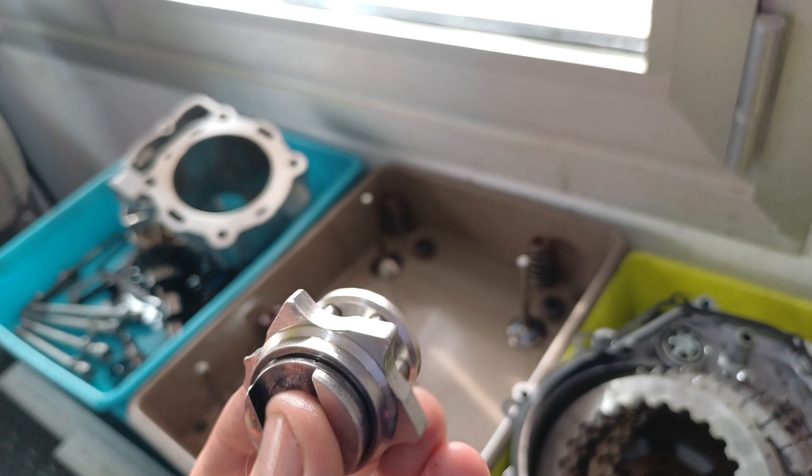Here's the crank. I have my little sketchy diagram here but it was all within tolerance. This is the original OEM crank having done 253 hours. It's difficult to show you with one hand, but there's hardly any movement — everything's a tight fit. There's a little bit of rub at the top there where you can see it's gone through, but it's all in good order. You can see the pin — that area is where the oil works, and that's all fine.